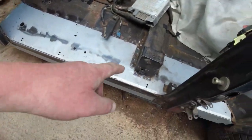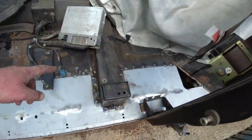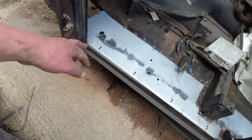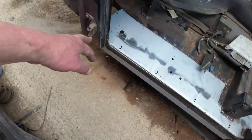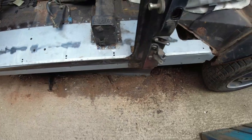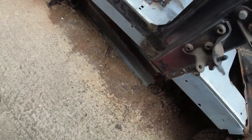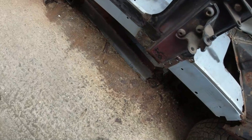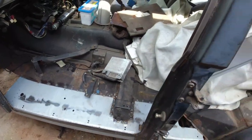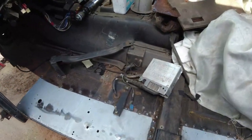Moving in the right direction — all plug-welded back into the original holes, not gone too far forward yet. Just need to flatten some of these welds back so they're all flush. No real warpage anywhere. Measured the gap between the base of the A post and B post along the weather-strip line, cut a piece of tape exactly the right size — and that's more or less what I've got. I've only plug-welded two of the welds at the back so far. Hoping the customer brings both doors for this side next week so I can hang them and finish the welding.